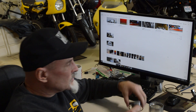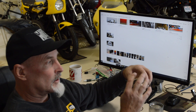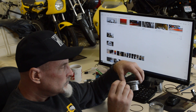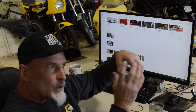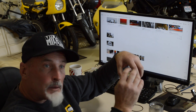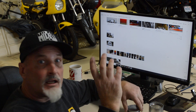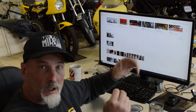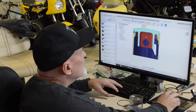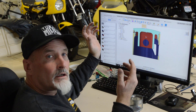What that tells us is that where the pin is, which is on the load side of the piston, is opening up — because it's allowing that ring to just get underneath the locating pin as it opens up. So conversely on the other side it has to be trapping the ring. So this is not really usable.